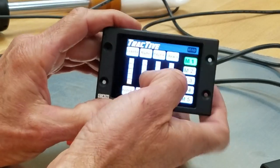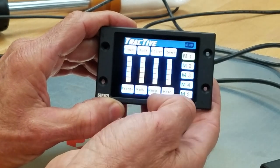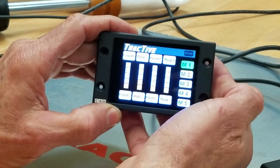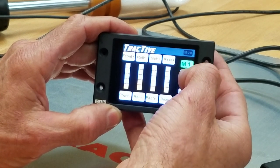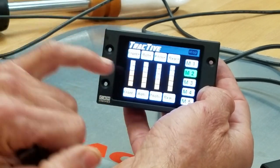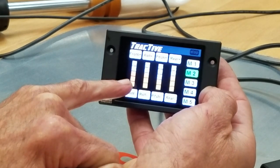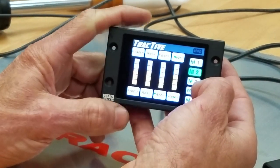You can see how it went from two bars to three bars in yellow — I just changed the roll stiffness. To save it, hold down the button. See how it's yellow when unsaved? Hold down and it turns green — it's saved. My second preset would be like a sport touring canyon setting where you want to be a little more responsive. I've bumped up the roll stiffness a little bit and a little more base shock setting — I don't mind if it rides a little firmer in the canyon.